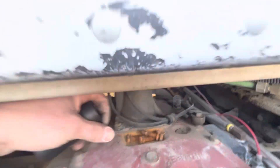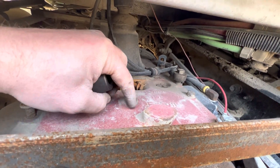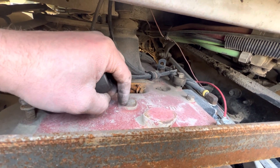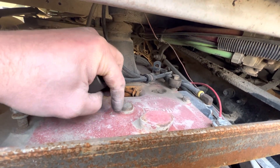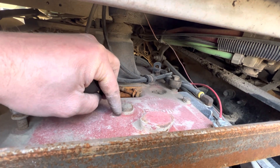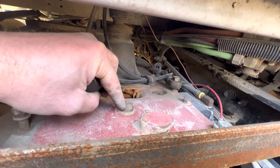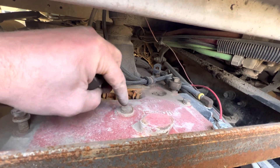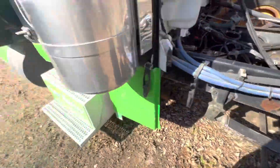Every time you do an inspection, majority of transmissions will have this kind of plug. If you start getting oil around it — oil starting to come out — that's a symptom. Your bearings in the transmission are loose and one shaft starts hitting this plug, moving it a little bit out, and you get oil. That means plan to replace your transmission sooner or later.